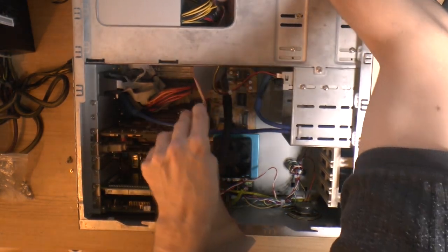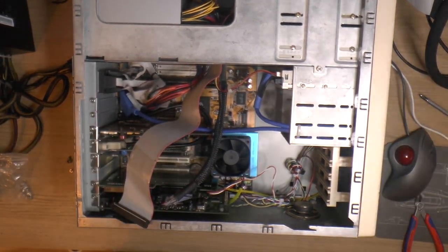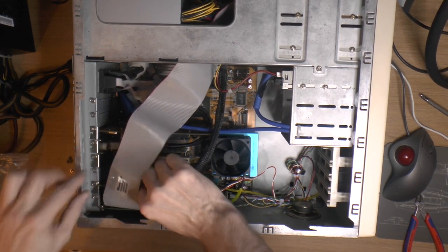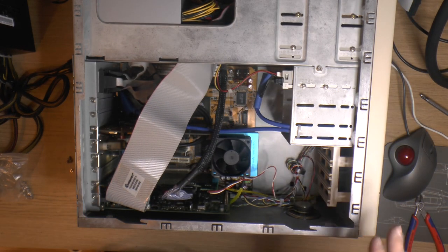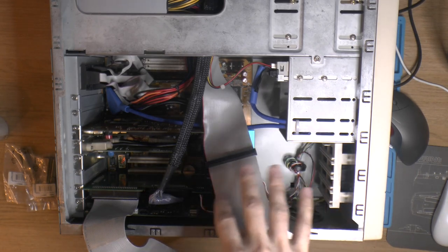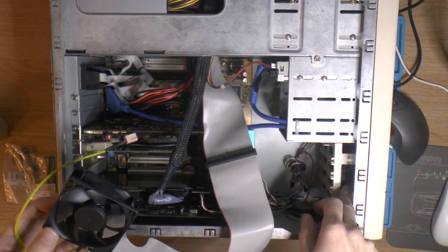Then we're going to make a new cable that is rounded and shaped to fit this case — you can see how annoying the flat cable is, it's unwieldy. They didn't use an angle connector, which would have been nice. So it's not going to look like that when we're done. I'm going to connect the other ends and then test it — make sure everything is hooked up correctly so we can move on with finalizing the build. The system boots up. There were a couple of front header pin connector issues, the SCSI was the wrong way, and the power lead was wrong, but otherwise it works.